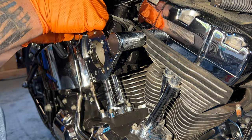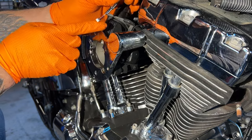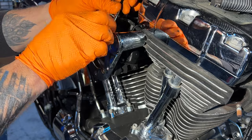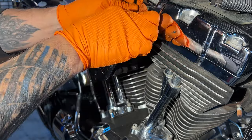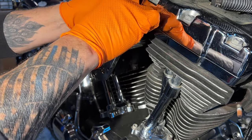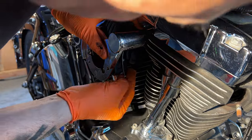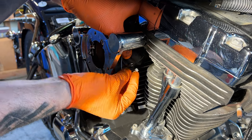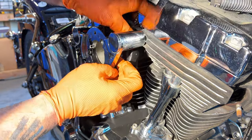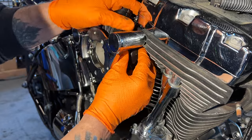And then I'm going to take the idle cable and push it back in through there a little bit. The idle cable — you can always tell because it has a little spring. You see that little spring right there? That spring goes inside this little cup right here — can you see that little cup? So what I'm going to do is lift that spring, because you want that spring to go inside of that little cup, just like that. And that spring is inside of there, so I'm going to pull this all the way, rotate this back and hold it like that. And then the idle cable — the little barrel there — goes in the front one just like that. And then you tuck that back in like so. And that is your idle cable.